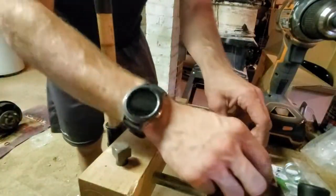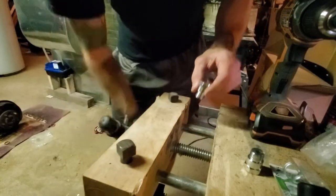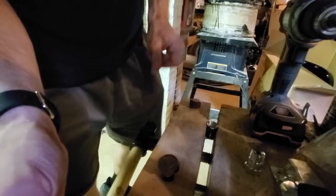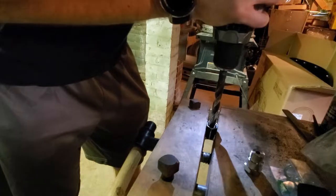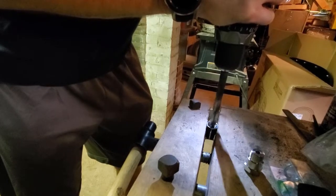You're going to take one of the non-foulers and put it in a vice. Be careful because it is aluminum — you don't want to mess up the threads on the outside or inside. Now with the defouler in the vice, grab your half-inch drill bit and drill straight down into it so you don't mess up the internal threads. As you guys can see, I drilled through the hole and widened it up, so now we'll be able to put our O2 sensor through there.